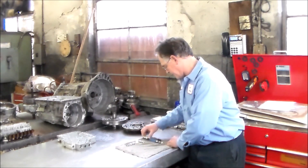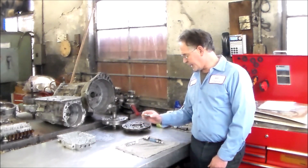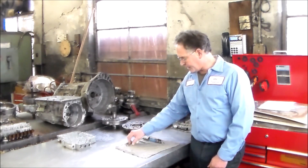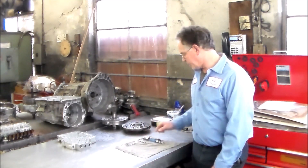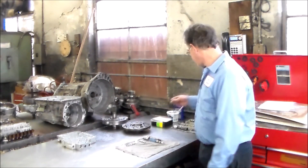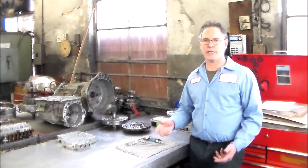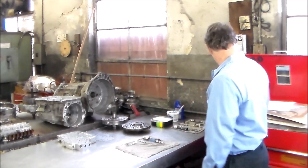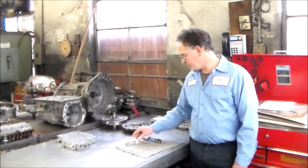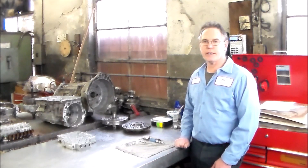I'm going to show you the contents of this kit. We're basically going to be changing the entire pressure regulator valve setup. There's an anti-rattle TCC valve, the O-ring end plug for the pressure regulator valve, and the solenoid feed screen. The solenoid feed screen is located behind the manual valve in the valve body. If that screen gets clogged, you can have second gear starts and line rise, so it's very important that gets checked and changed. The shift kit gives you a different style screen to install.